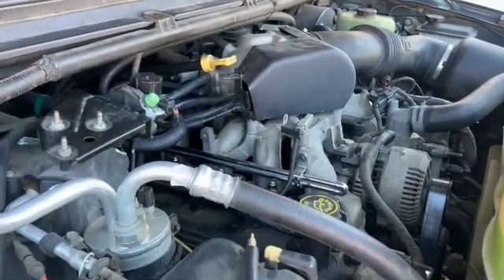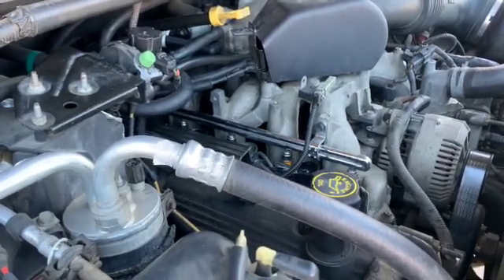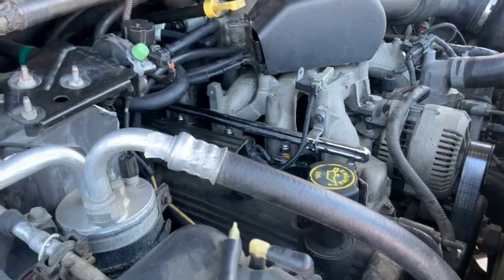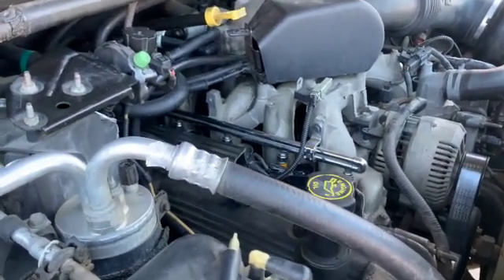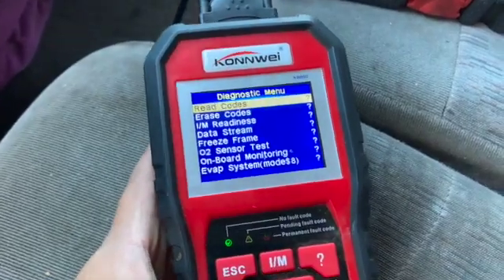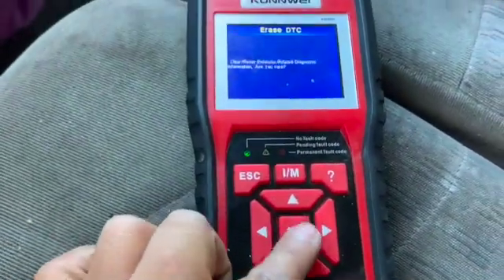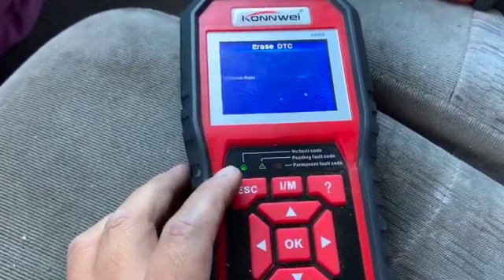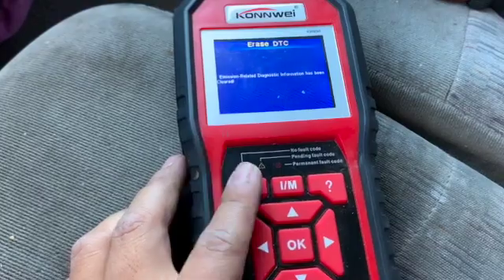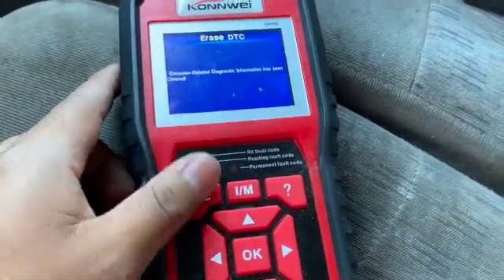That's how you test your coil by swapping with a known good one. I didn't replace the coils because it's about 60 dollars each and I need 10. Hopefully we don't have to replace it, but if so we'll go to the junkyard. Let's clear the code - all you have to do is erase it and confirm, then it's ready for a test drive. Drive it for about five to ten minutes - the check engine light should come back on shortly if the coil is bad.